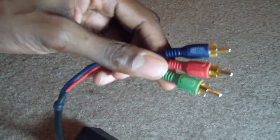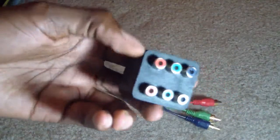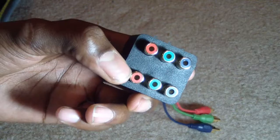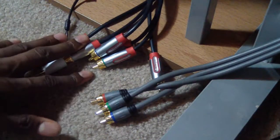You also need another set of component cables — the same HD cables, blue, green, and red. You're going to need another set to make this work because one end goes to the TV and the other end goes to the AVerMedia card. So let's set this up — here is the Xbox 360 and here are the extra component cables I bought.